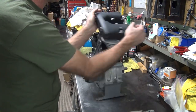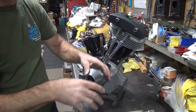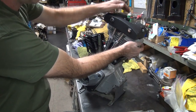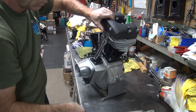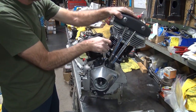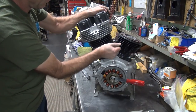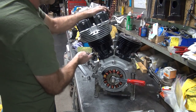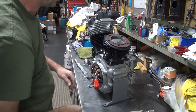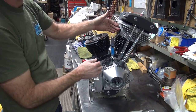All the bolts are up until they're touching it right now. You have a little bit of movement on the head, so you want to rotate it toward the inside — so both heads kind of rotate like this. I just pull on it and go back and forth a little bit to put a twist on it. I'm pushing hard where my palm is, making it rotate. I'll tighten the bolt down just a little bit — same torque pattern, back to the center one, then down here. That's only like five or six foot-pounds of torque, not much. The head's totally rotated in right now so the intake manifold is closer together. When you rotate the heads like that, they get close to the flanges.